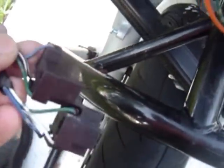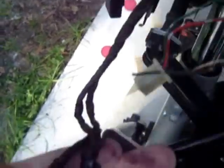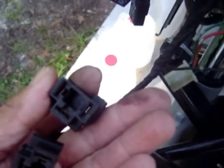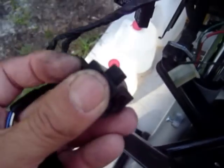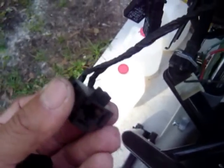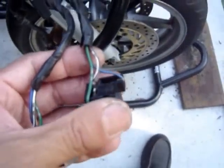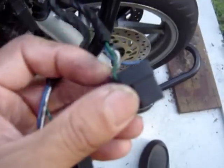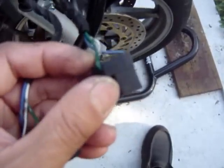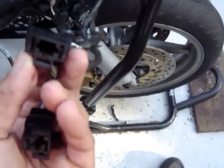As far as the headlights, I didn't have headlights — I didn't have power. I didn't know if it was the signal relay, the headlight relay, or somebody had cut the wire. So I checked continuity: green is ground, green to the chassis — it was dead. That told me something. It took a while before I realized that the negative plug in the starter relay was not getting continuity due to corrosion. So my ground was dead at the starter relay.